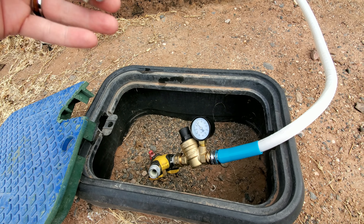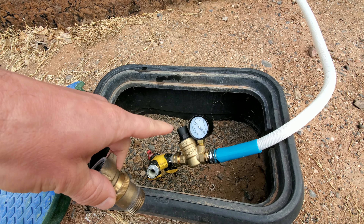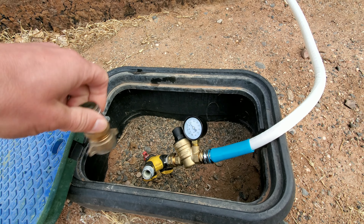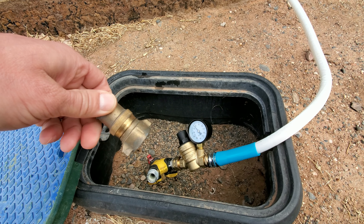There was one fitting that was a little bit looser than the rest — that was the weakest point, so it would cause a drip. It would drip for about four or five minutes, then we'd use the water, and when I came to check it, it wouldn't be leaking, but we'd have a puddle on the ground. I finally put two and two together. Most of you know what these are — both of these are water pressure regulators. This is a nine-dollar version and that's a thirty-five dollar version. I started using the nine-dollar version because our other one broke. We used it for about a month and it failed. How do I know it failed? When you turn your water on at the faucet and the pressure surges and then dies back down to normal — that's your first sign the regulator is failing.